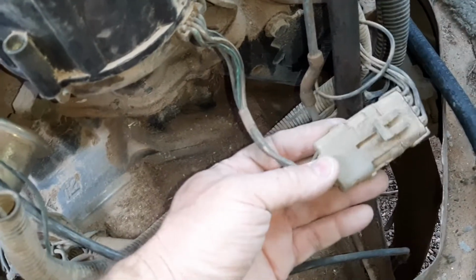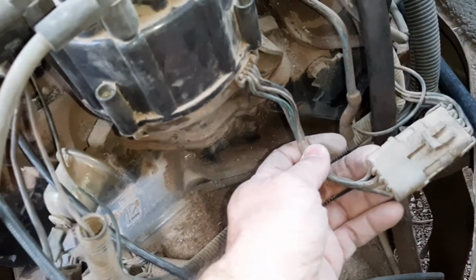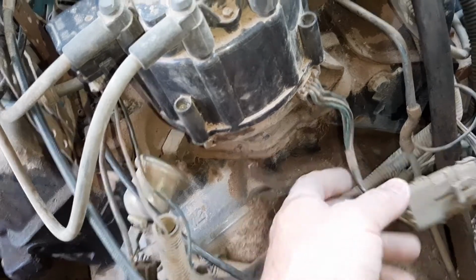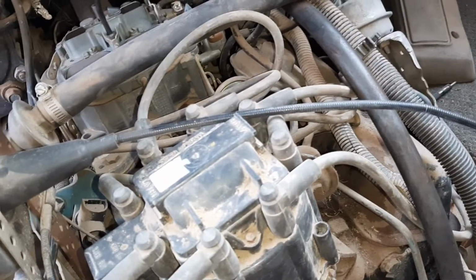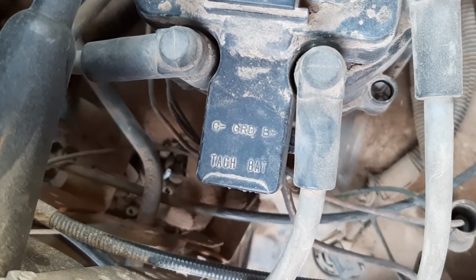So I looked at this little harness. I don't know what this is for. If any of you know what it's for, leave a comment. But anyway, this is a 4-wire hookup, and I thought maybe it was sending power to the distributor. But then I remembered that the distributor power comes in here. I don't know if you can see that. Right there, it says BAT, battery.